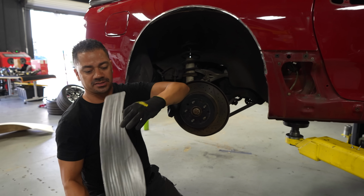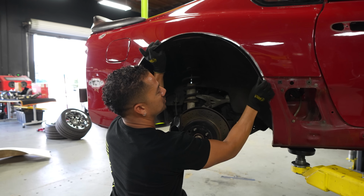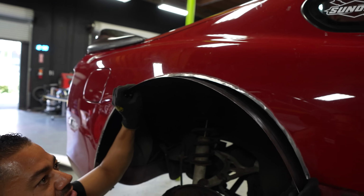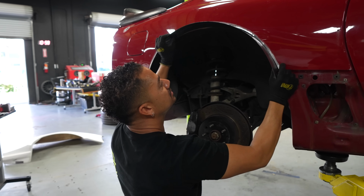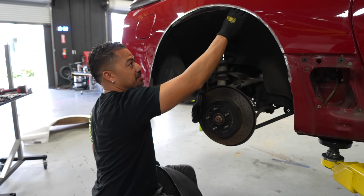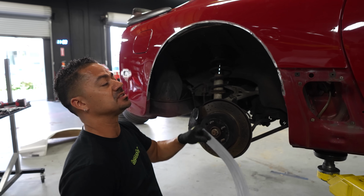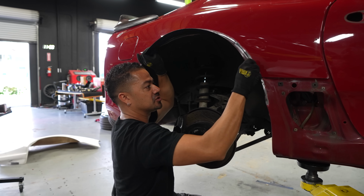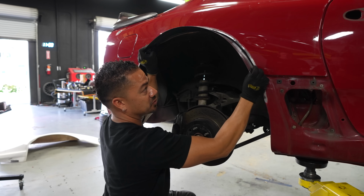They ended up doing this yesterday, which is the panel that goes over the original quarter panel. And this space that you see here is what's gonna be the gap missing between the new quarter panel and the existing quarter panel. And it also opens up the entire wheel well area. And because you open it up, now you have a big hole here that goes into the cabin, which is what this does. This covers up the existing hole, and it makes everything back to seal from the weather and everything around it back again like if it was from factory, but with a wide body kit now.